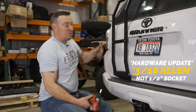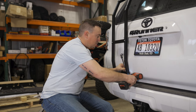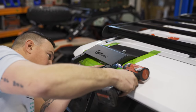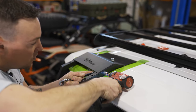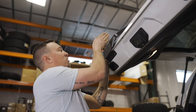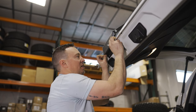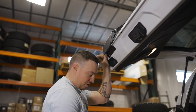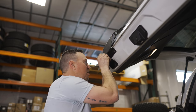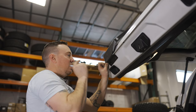So we double checked our alignment, made sure we're straight, and then we're going to raise the lift gate up a little bit. Just make sure before you mark these holes to drill that you're pushing up good into the corner of the vehicle just to make sure it's going to sit right when we get it bolted. Then we're going to mark the entire hole — not just a dot. We want to know exactly how big the hole is and where the center is. Mark the entire hole, then undo this and get our drill going.